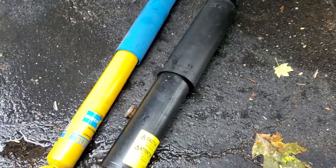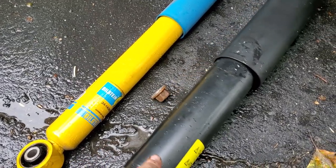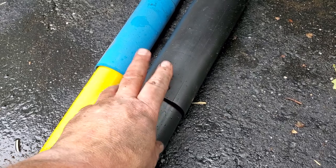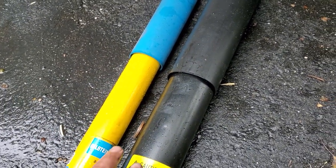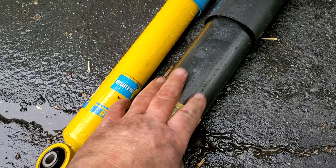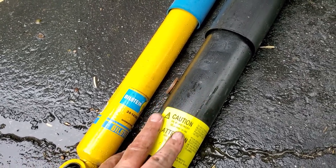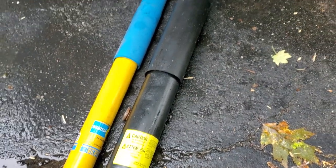Little did I know that the shocks were designed as an auto-leveling feature. Internally, it's got about a 0.9-inch diameter piston and it's hollow — the piston itself is hollow. This is a monotube design, extremely high pressure. You cannot compress this down; it's impossible.